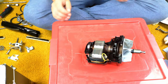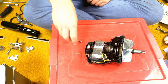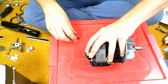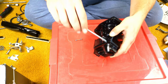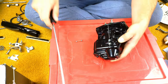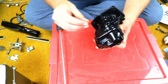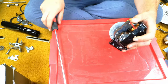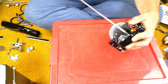With the front bearing clamp down, I use just two little lock washers — you could even use the bracket from the old suppressor. What we need to do is get our coil screws and screw the coil down, but these just take up a little bit of extra width. I'm always a bit paranoid about punching through the side of the housing and knackering the armature — it just seems right to give it a little bit of spacing. With those screws done up, we turn it around and find our rear bearing, rear bearing screw, and rear bearing bolts — it has both.